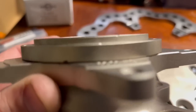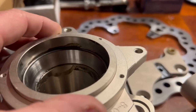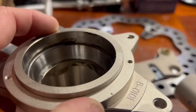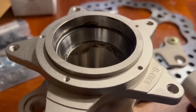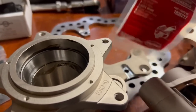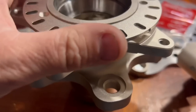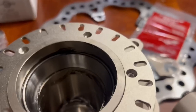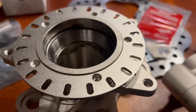You have to make sure the ring is oriented the proper way — just like when you're putting in bearings in the engine, you want that radius part so it fits all the way down in there. It's a pretty snug fit. What they do is send you Loctite 680 in the kit — that's a retaining compound. The ring itself just goes on here and bolts down, then your sensor bolts through your bracket, and you can monitor front wheel speed.